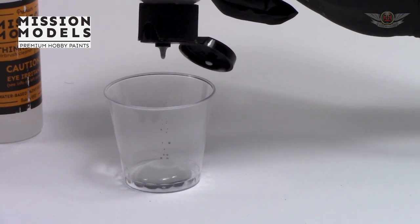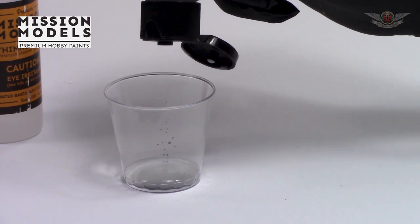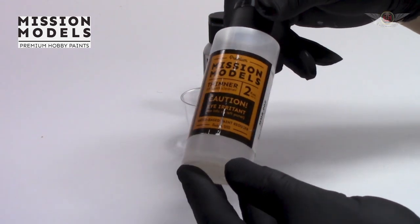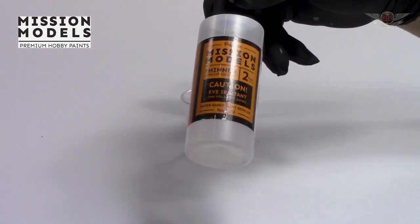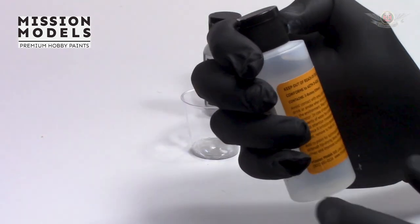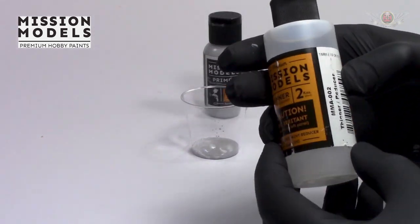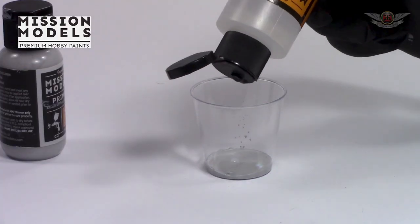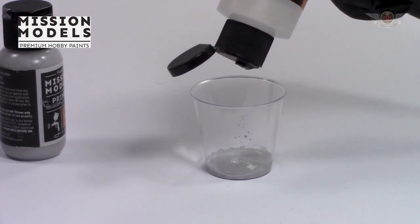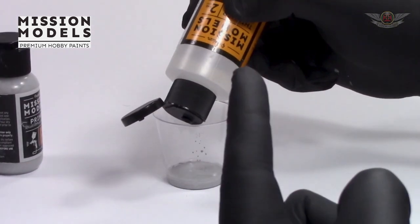And then we apply 6% of thinner, in this case, 6 drops of thinner. Each part, 10 drops, okay? And 6% of thinner. It's concentrated, then you mix it all up, and I found out that between 15 to 18 PSI, it's perfect. I actually started by using a bigger pressure, and I ran out of primer. But that was my mistake, okay?